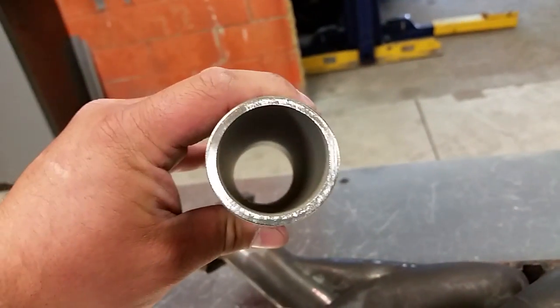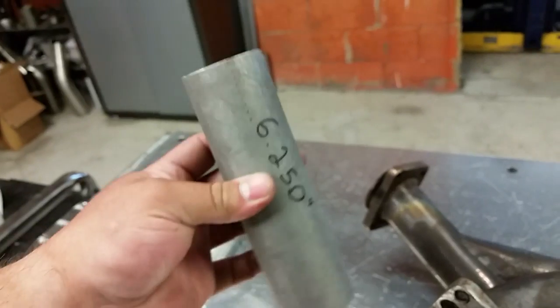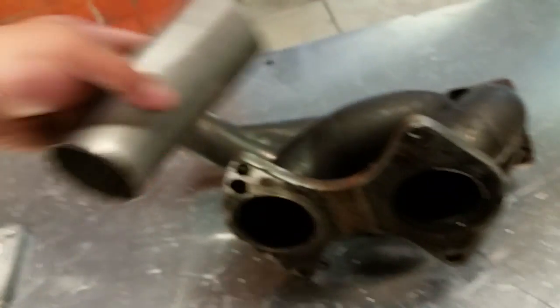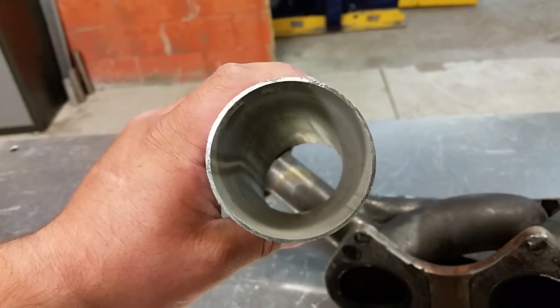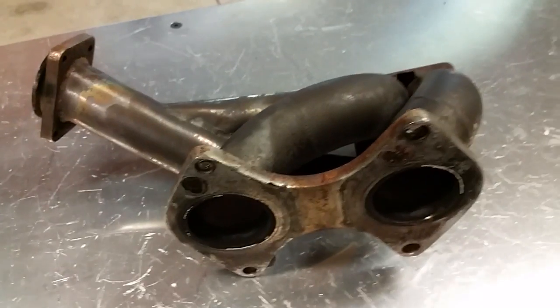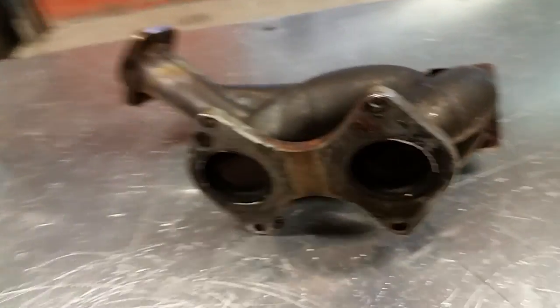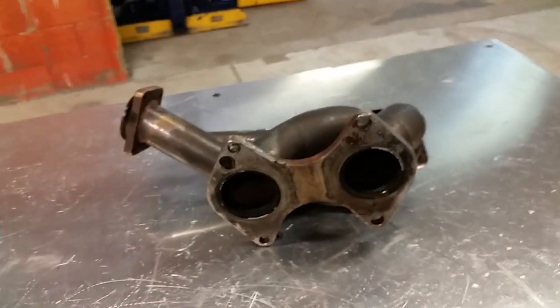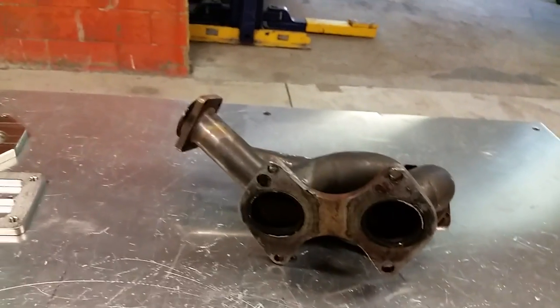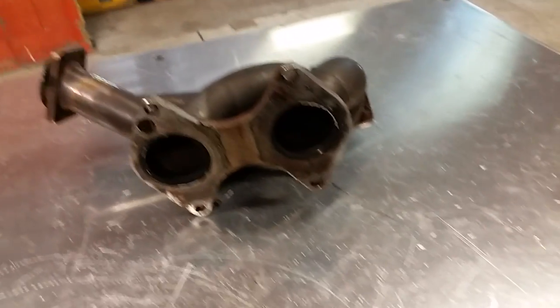So those primaries are absolutely huge. Now keep in mind, this is Sked 40 pipe, so this is over an 1/8 inch thick wall. Absolutely massive. Just the density of this is unreal. This is what these are made of. Just .065, your regular exhaust tubing, which is great for exhaust duty. But when you've got something that goes brown like this so quickly, it glows 24/7 and goes in and out of heat cycles, it's just not realistic unless you make it out of Inconel or 321, and you can get away with thin wall stuff on that, and that's what race car teams do, but not at this price point.